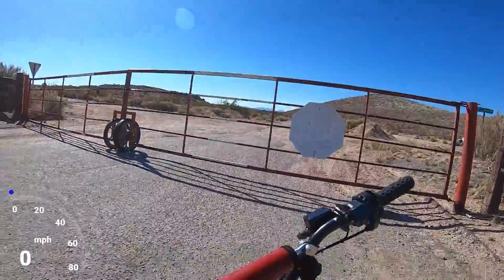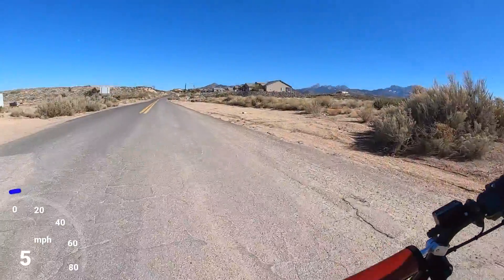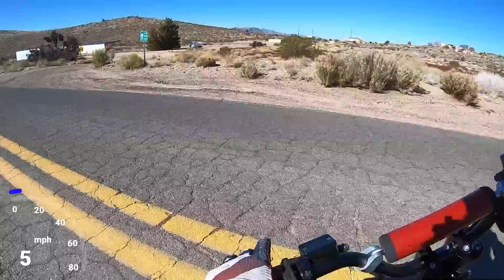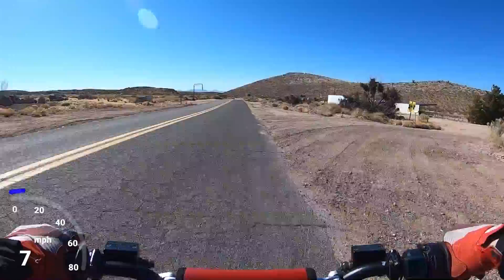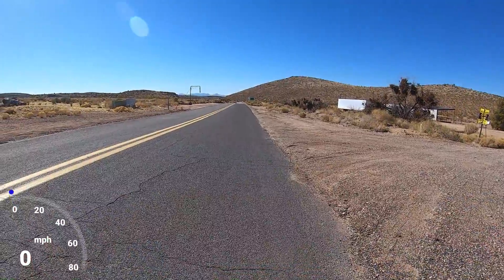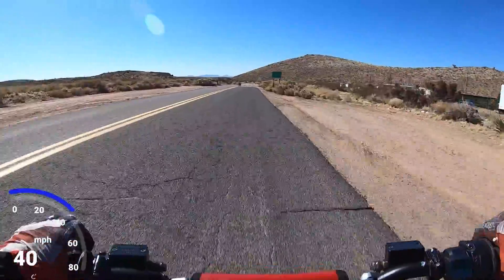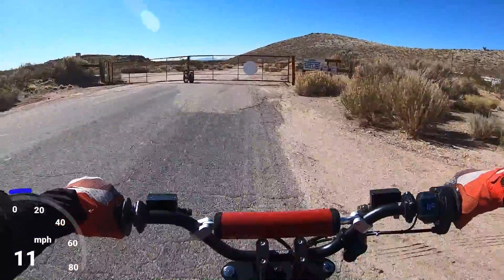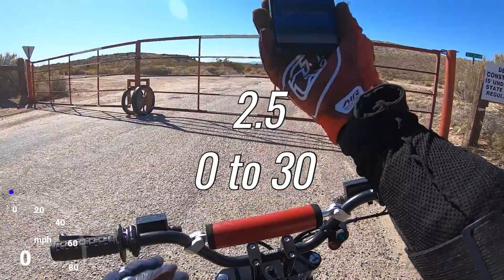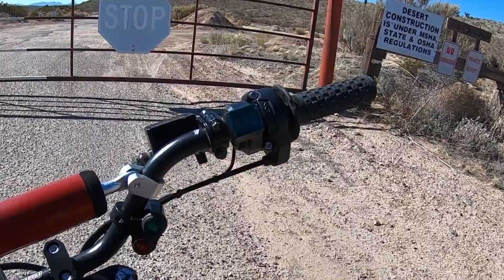Let me see if I can launch it at 100% power — I'm pretty sure I can with this swing arm. I'll leave the torque setting in the app to max and see if I can launch it. We started out with about 87.5 volts and now we are at 81.3. 0 to 30 QS138 with the Noisy Cricket — I kind of rolled into it a little bit. We did a 2.5 seconds, and I think I could get this bike into the one-second range for sure. We're at 81 volts so the voltage is down just a little bit.